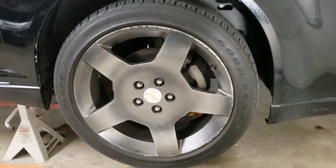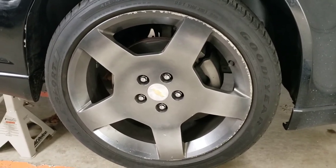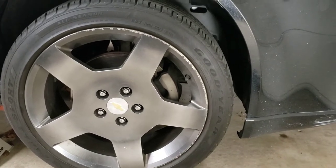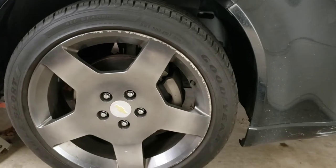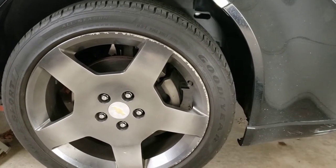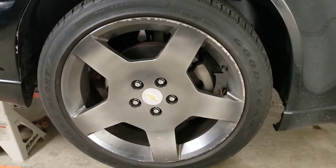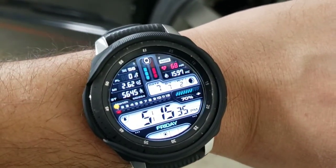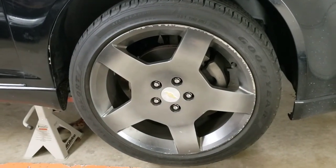All right, so the next step I need to do is take these old wheels off and start the teardown process. I take the lug nuts off, take the wheel off. Then I'm gonna take the hardware off of the caliper. Take the caliper off, take the brake pads off. I'll show you all the good stuff right now. Or, what time is it? 5:15, it's already dark. We're gonna do this tomorrow morning. I'll see you guys in the morning.